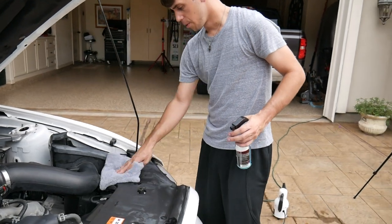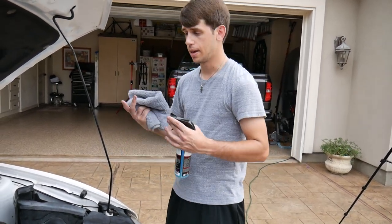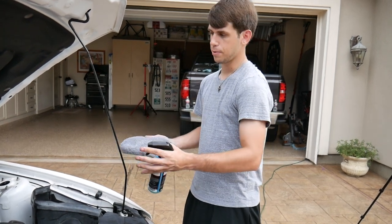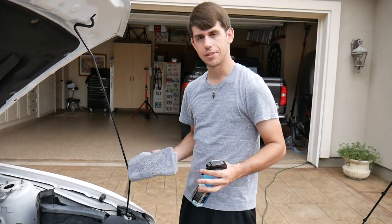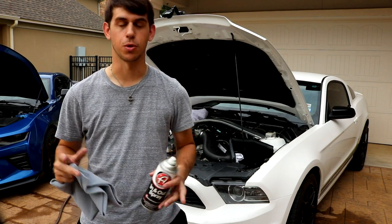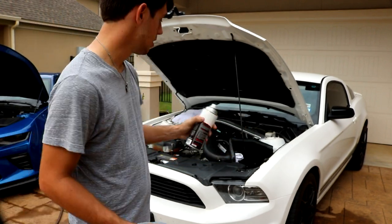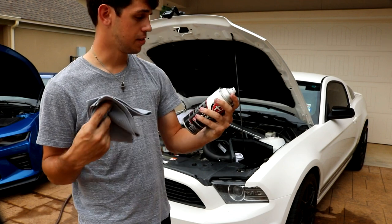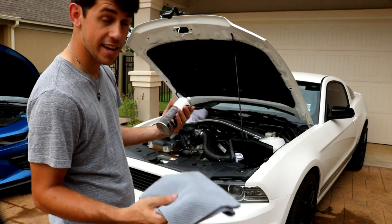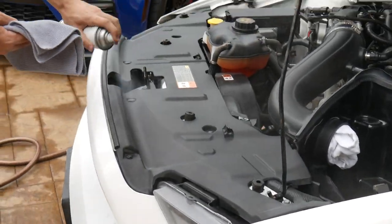For example, if you have a Mercedes or something where the engine is entirely covered in plastic, you can actually use a wash bucket, an old wash mitt, and car wash soap to wash all the plastic parts. With this specific motor that wouldn't really benefit me as much as the brush method, but it's a good option. Before we move to the Camaro, there's one last step — my little secret before car shows — and that is the Adams Polishes In & Out Spray, which is an aerosol spray for plastic and vinyl that coats and enhances faded plastic and vinyl, leaving plastic, vinyl trim, grills, and moldings black and dark. Shake it up and spray it on one section at a time.